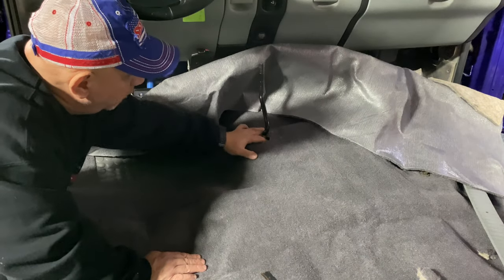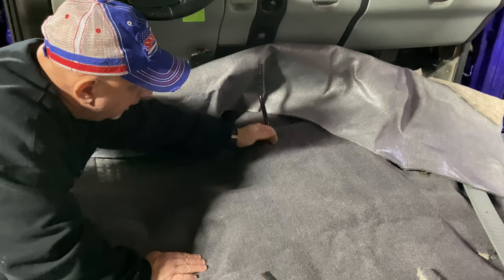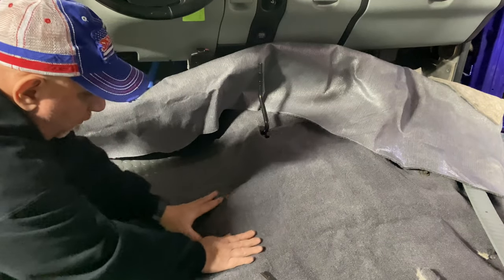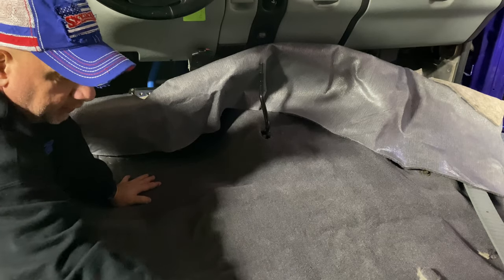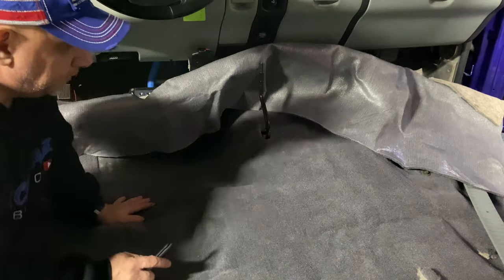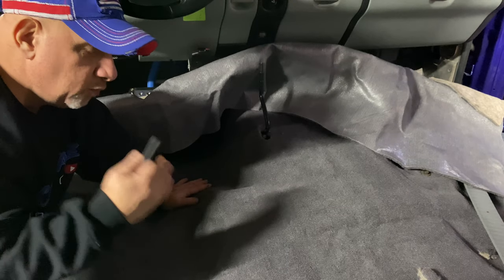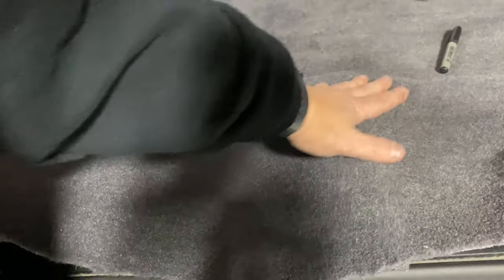Now that I have my gear selector for the four wheel drive all mocked up in here, I did have to make the hole a little bit bigger so I have a little bit of play either way. Being that this is a molded carpet, there's a mold right here, and this is where you want to be careful on what you're cutting. This is one of those jobs where the longer you spend doing it the nicer it's going to be. I'll lay the carpet down, stretch and pull it to where I need it, mark it with the sharpie from the top, then make an X cut and cut a little hole around where each bolt goes.